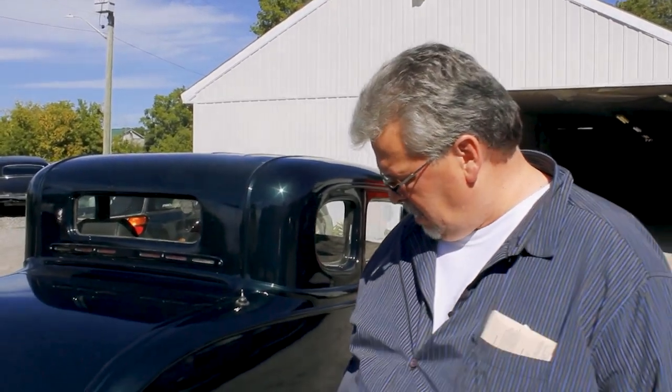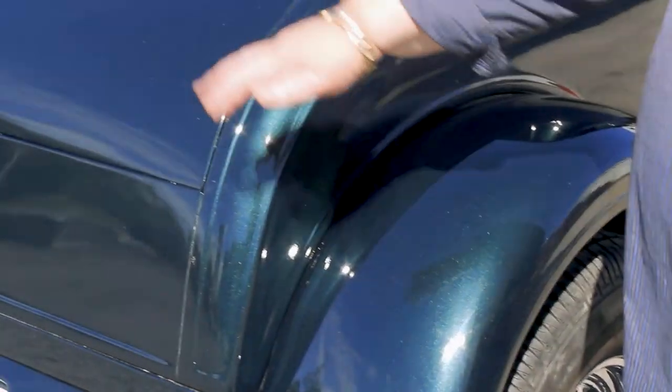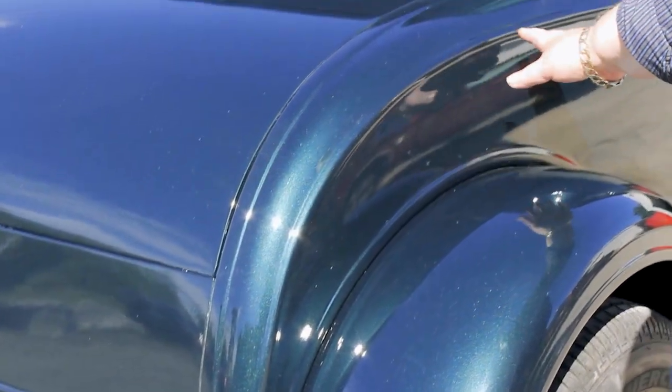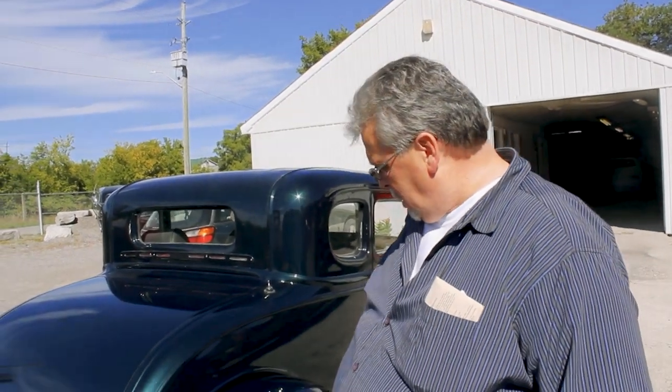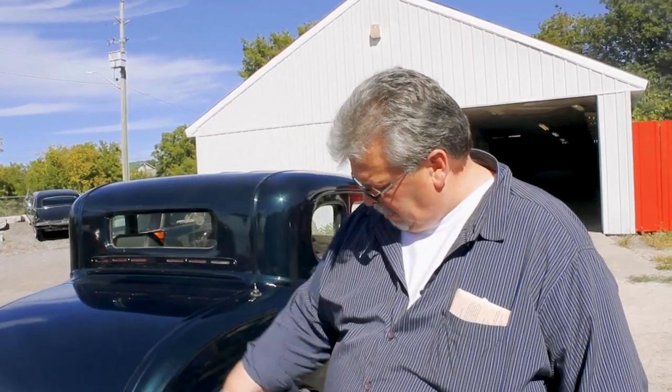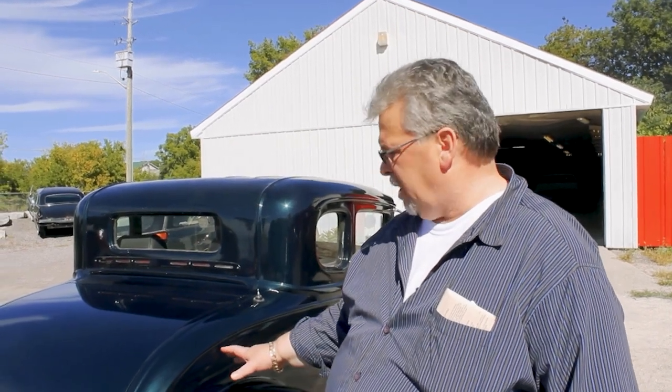We've just finished up on the 31 Ford that's been in for the accident. If you recall earlier, this fender, the lower valance, all this up in here had been damaged from the brick falling on it. They'd been involved in an accident where the accelerator had stuck, and the guy had the car for one day and went right into the garage center post. So we were able to recreate all this for him, straighten all this out. There was some structural stuff underneath. There was a box and frame rail that was bent, so there's a bit of extra work in this one.